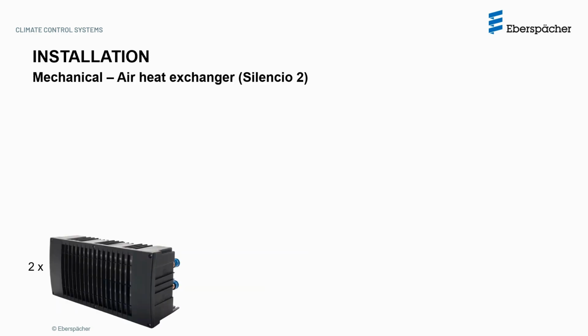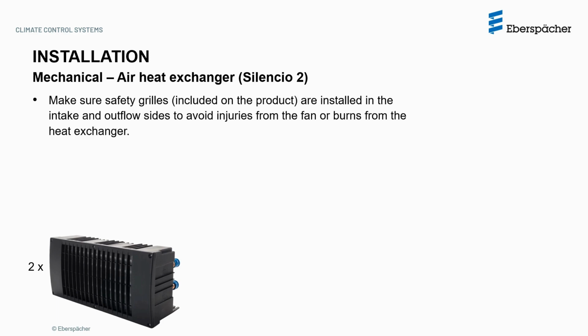There are 2 units of the Silencio 2 air heat exchangers included in the kit. Make sure the safety grills, which are included on the product, are installed in the intake and outflow sides to avoid injuries from the fan or burns from the heat exchanger. The rear of the units must have access to an air return to draw air to be heated.